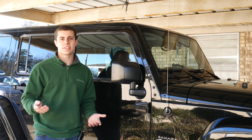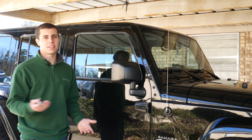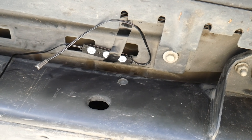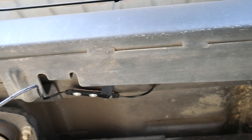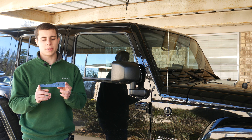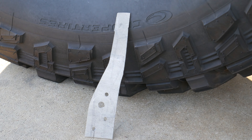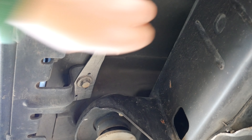Our first project is going to be installing the convenience slash puddle lights under the Jeep. We'll want those to turn on whenever we open the door, press unlock, or flip a switch inside. I'm going to be mounting two lights on each side — one near the front of the rock rail and one near the back. I'm actually going to be mounting them on little mounts I'm making out of aluminum, just a piece cut to fit, and this is going to keep us from having to drill into the frame of the Jeep.